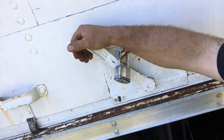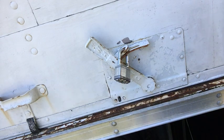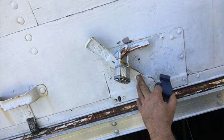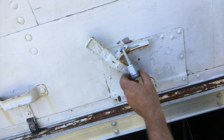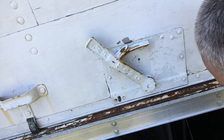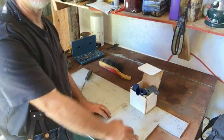As you can see, this is also a Whiting handle but it's different, so I have to modify this a little bit. This handle comes out further away from the door than the one on the back side of the truck, so I have to build a little standoff for this bracket to fit around this lock — three-eighths of an inch that I have to build out in order for the handle to fit on this plate. If someone cuts this off, that's a concern, so this type of lock adds protection. We'll take all this hardware over to the shop.